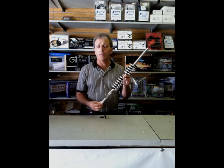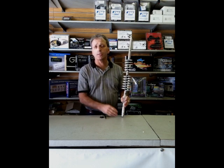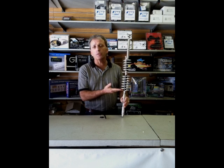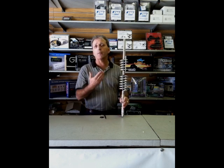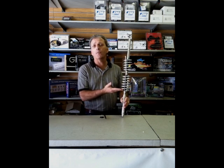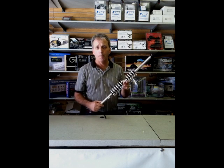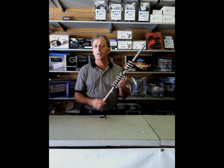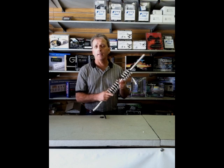You might wonder what's the significance of the shaft length. It is extremely important to have this coil even with or slightly above the top of the vehicle. Wherever you are mounting it, you never want this portion of the coil to be below the top of the vehicle — this is where the majority of the signal radiates from. It doesn't equally radiate from the bottom to the top of the antenna; the majority of the signal radiates right here. You utilize the vehicle's roof as a ground plane, so for the SWRs to set correctly and for the performance of the antenna to be a high-dB gain system on transmit, this coil really does need to be at the right height. It is critical.